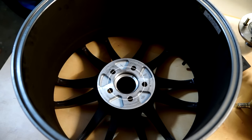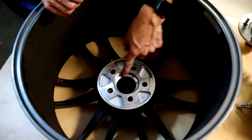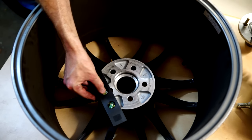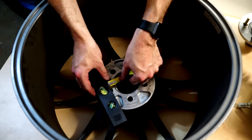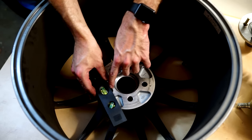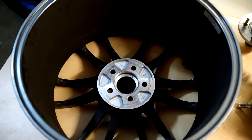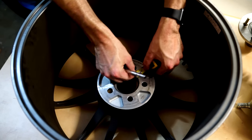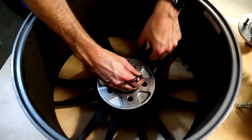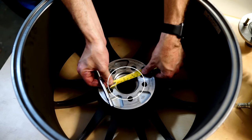How do we actually measure that without a virtual circle? It's actually very easy — all we need is a simple reference point. We can use the hard edge of the hub bore as a reference point. Drop a line in the center of the circle and measure the distance from that point to a reference point on the hub. We get a reference of 15 millimeters — the distance from the center of the hole to the hard edge. Then draw a straight line across and measure that exact same distance from the center line on the other side, mark it, and measure from the center of the first hole to where we placed our dot — exactly 100 millimeters.